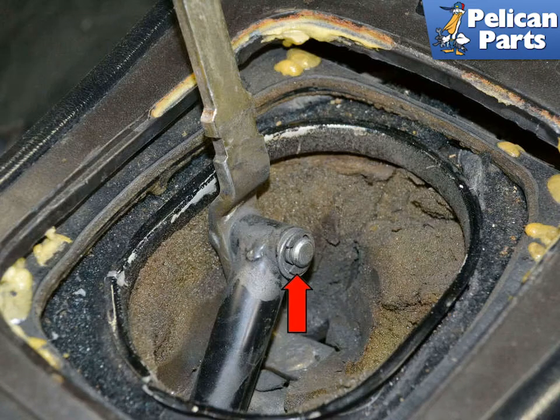Remove the shift knob cover and separate the knob linkage from the shift shaft — on our car it was a circlip. Separate the shift shaft and knob linkage and turn the shaft, pushing it all the way forward under the console between the foam. This will remove the shift shaft from the transaxle tube in the rear.